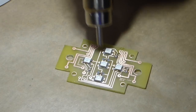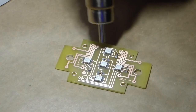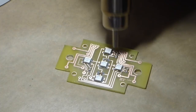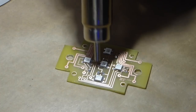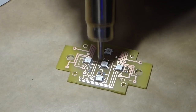You know that magic moment when the solder paste flux and everything melts and then reflows? Shit, want that. That should be okay. When you get a good preheat going, you can move from one component to the next. And I say this as if I'm an expert, because this is like the third time I've ever done this.